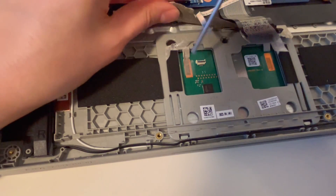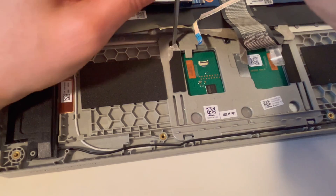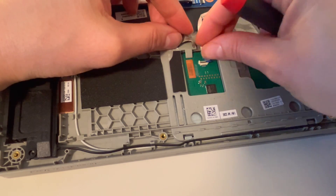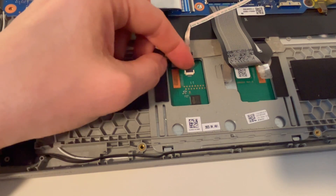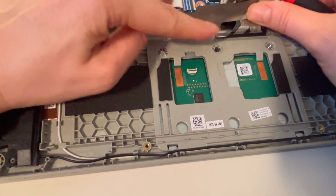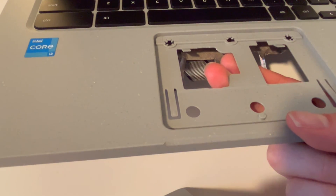Removing the last bit of tape — the ribbon cable popped off just like that. Now I'm going to remove this last screw, but just so you can see what it looks like, I'll plug it back in so you can see how to remove it: lift up on the little black flap and gently pull it up like so. Now that it's loose, I'm going to flip over the laptop, take two fingers, push on the touchpad from behind, and it pops right out.